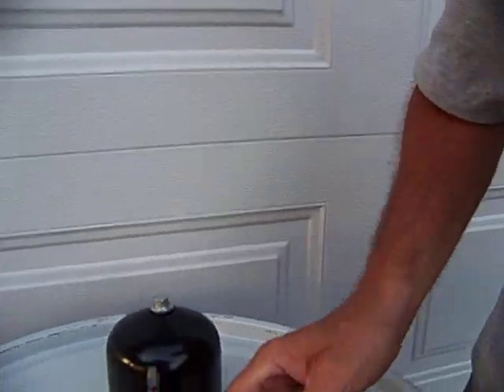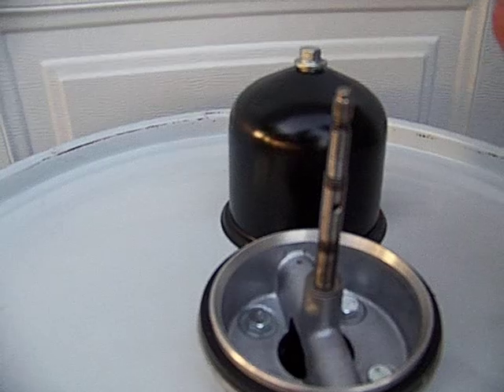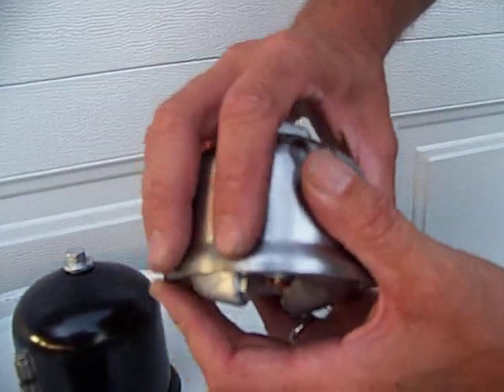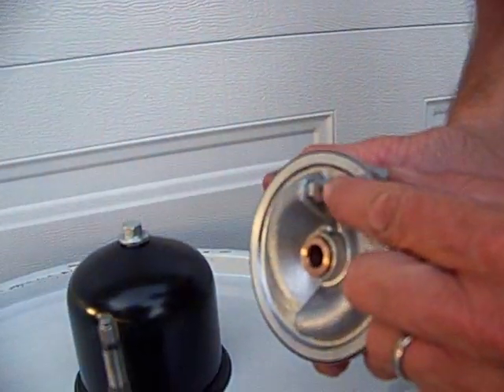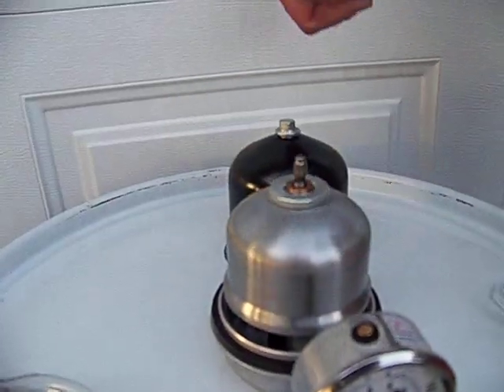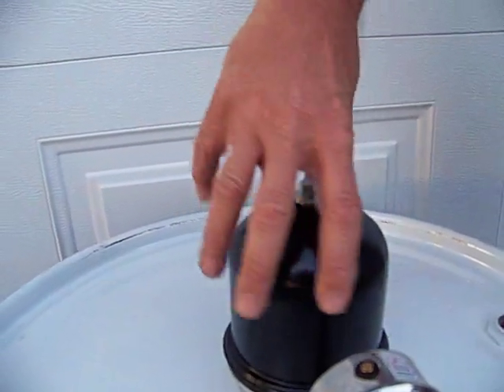The centrifuge — this is the rotor. The oil comes in here, up the shaft. Notice the two holes. It sits on this. There's two holes in the rotor. As this fills up, once it's full, under pressure, it's shot through these two nozzles, causing it to spin. There you go — nice, quiet spin.